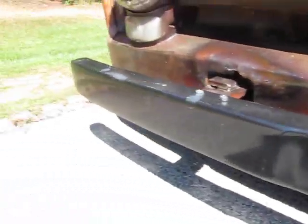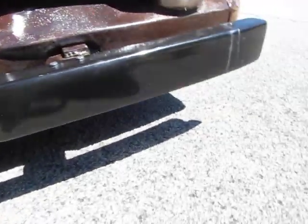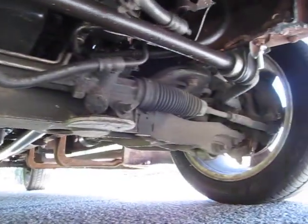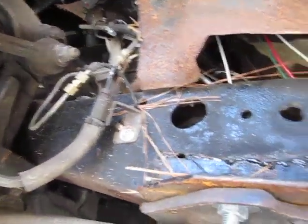I believe this may be a newer front bumper — it looks new aside from some peeling paint, and it's very very straight. Really solid underneath. You've got rack and pinion steering and all the front end from the Crown Vic. These front ends typically are bolted and welded — you'll see the bolts here and the welds. They look really clean and good.